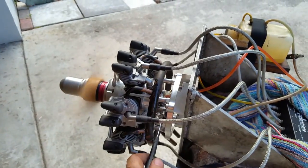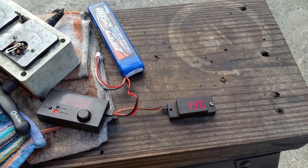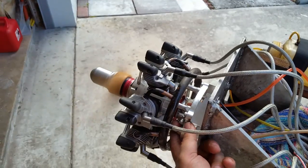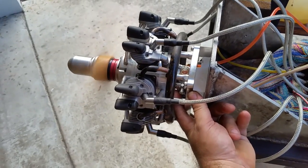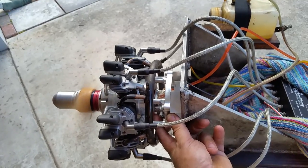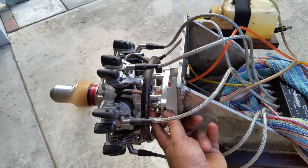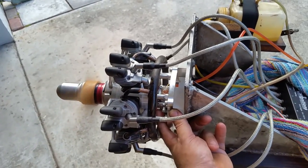Let me try to bring the idle just a tad lower. I didn't make the throttle linkage — I have it but I didn't install it, I forgot about it. For the transition and top end you adjust the fuel pump. The ASP pump from Vogelsang, made in Germany — that also works really well. It's a really good pump, but it's 250 bucks, quite pricey.